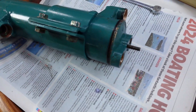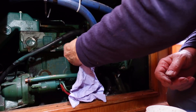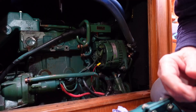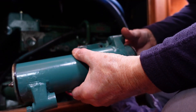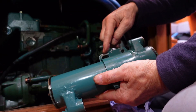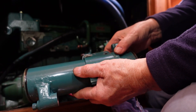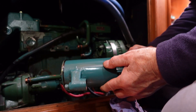There it is, assembled again. Now to clean the pipe ends, lubricate the O-rings with silicone grease, and then put it all back together again. We put the first bolt into this slot here, and then the heat exchanger can go back — it'll be supported by this bolt, and then you can slide it forward and mate it with all the connections. That's the idea anyway.